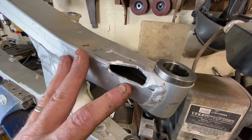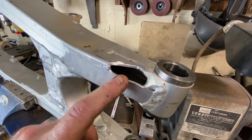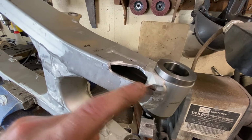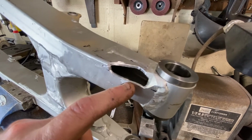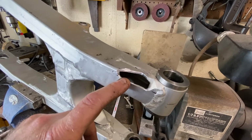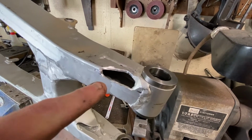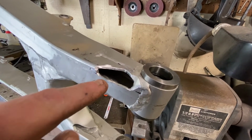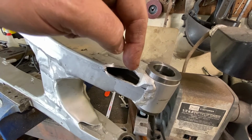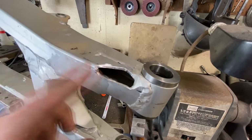I'm not too worried about strength here. This is pretty beefy, but I'd be concerned about, number one, aesthetics, and number two, internal corrosion on this thing, so I want to seal this up. Plus the strength aspect of it. Even some 1/8 inch aluminum, I can cut that and make that for him. So picture a triangle going in on this plane, and then 2 straight pieces, 1 and 1, that would meet that, and he can just take that in. I think that this will work.